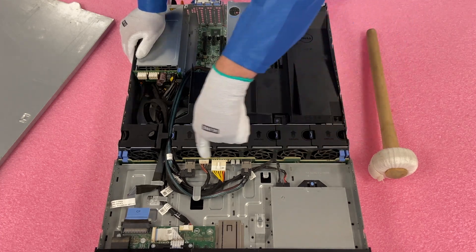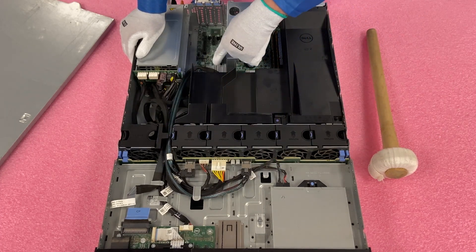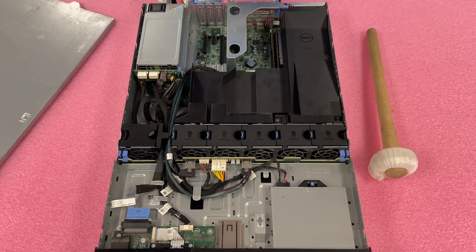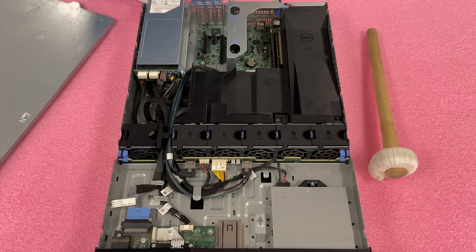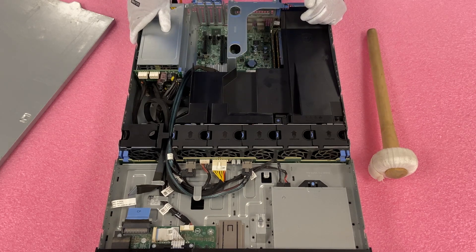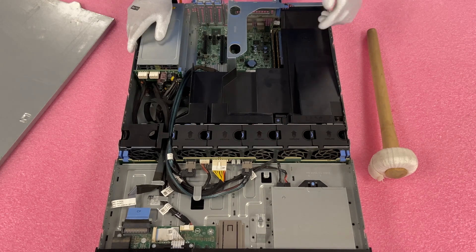Right here is going to be your backplane, and your backplane is going to have the eight slots for the hot swap drives. You're going to have your RAID cable or SAS cable that comes around and down to the board. Back here are your redundant hot swap power supplies — you can pull this one out right here, this one's a 1100 watt. We'll show you the different power supply options coming up. There are five PCIe slots: two of them are full height and three are low profile brackets, PCIe 2.0 as far as the generation.